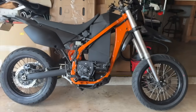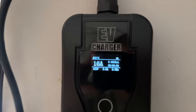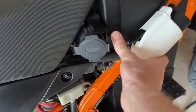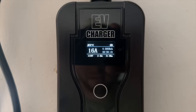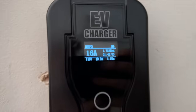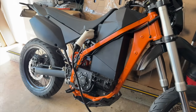Now we are back at the house with the Enduro e-bike. I just want to see if it will charge — I don't know what that issue was at that charger. Here's my charger, just running off 110 volts. It sounds like we are charging. For some reason we're only at 2.6 amps initially. After a little bit of time charging, we're back at 10 amps, or 1.2 kilowatts, which is what this charger is capable of. When the battery pack is pretty low in voltage, the charger limits the charging current.